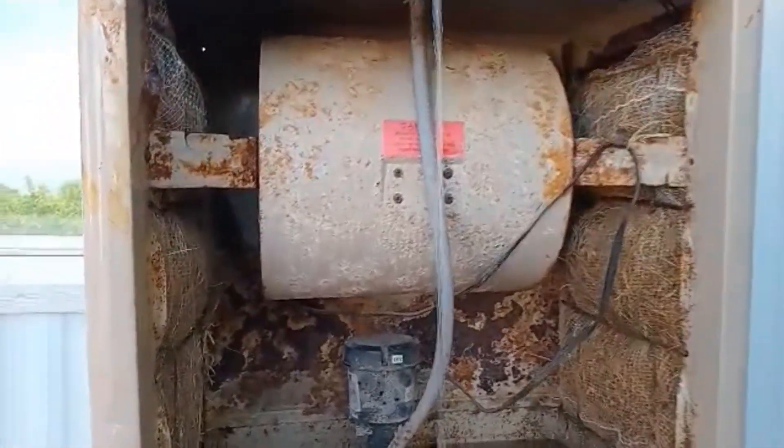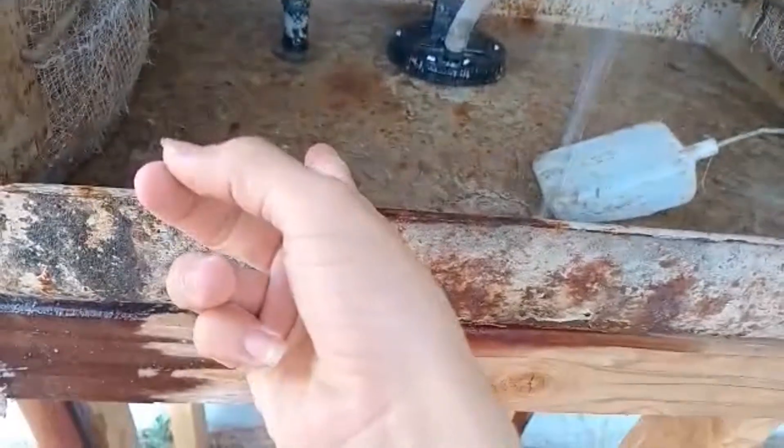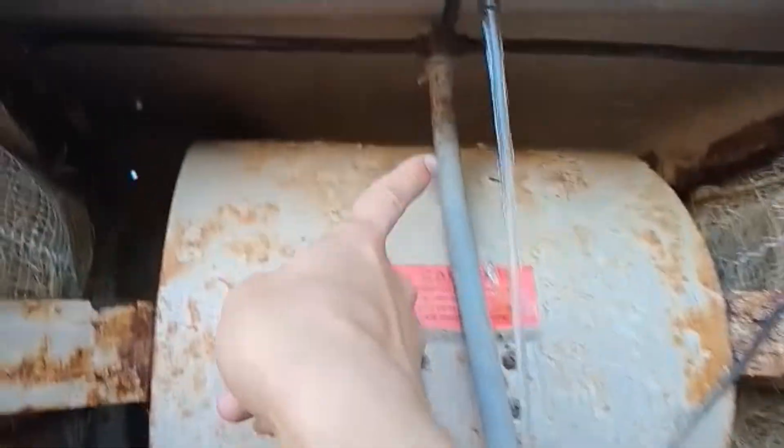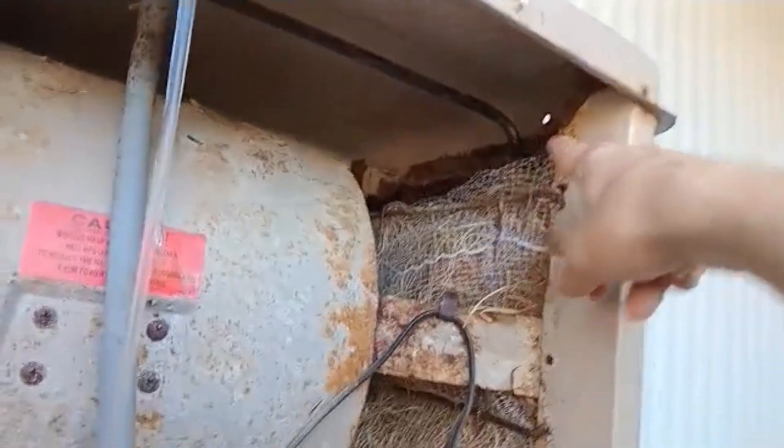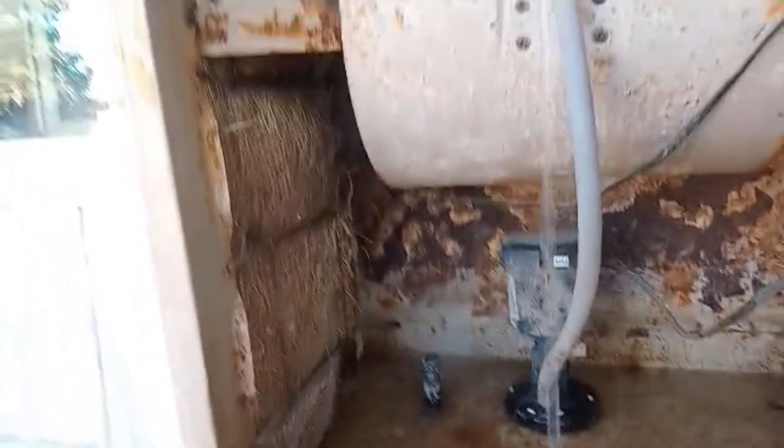Inside the machine you have a big circular fan, and a water pump sucking water up from the pan through a tube all the way to the top, dispensing it into a little trough. The trough has holes in it to distribute the water, though they can get rusted out and filled with gunk. In my case it's rotting — the whole thing broke off over there. How the water gets in is via a float hooked up to a valve which connects to a quarter-inch pipe. When the water is too low it turns on; when it's high enough it turns off.